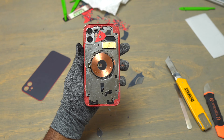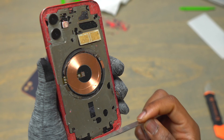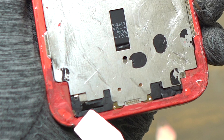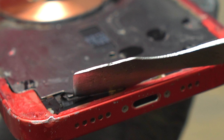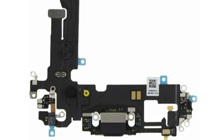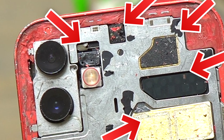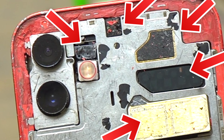I tested everything in this device and couldn't find what was broken at the bottom left — there is one wire that was cut, but cable charging is still working. Something is broken, and I will try to find and replace it in the other portion of this back replacement. After completing the full restoration, I identified the damaged component: it was the microphone at the bottom of the device. The iPhone 12 has three microphones — one at the bottom, one on the back directly above the flashlight, and one at the front. The microphone area on the back is also an exposed area where you need to be careful. All areas marked with arrows are exposed and not covered by the metallic shield.